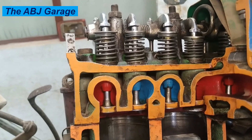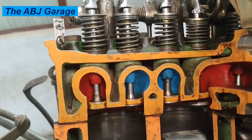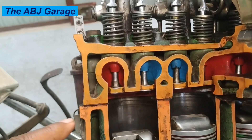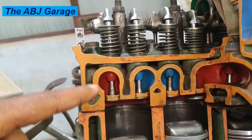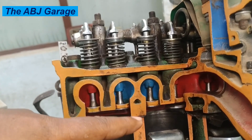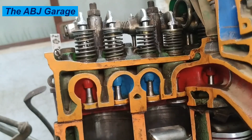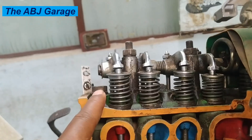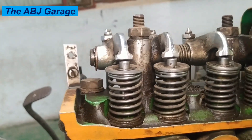The cylinder head is a very large, intricate metal casting, usually made of aluminium or some kind of cast iron alloy. It sits precisely on the top of the engine block. As you can see right here, this is the distinct line where there is a cylinder head gasket — above that we have the cylinder head, and below that we have the engine block. The cylinder head is bolted with immense force using bolts fixing it to the engine block.